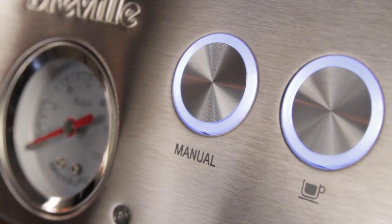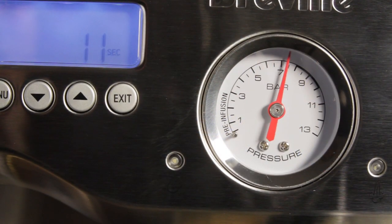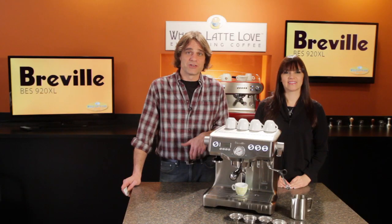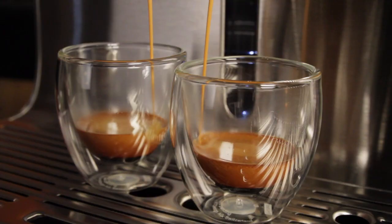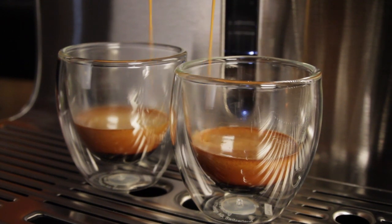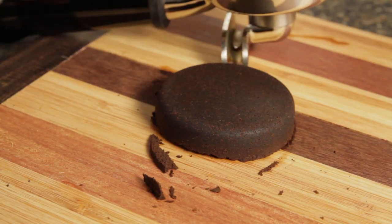Or you can go completely manual with a dedicated button for that. It's got a pressure gauge that will help you dial in the grind, temperature, and pre-infusion settings by letting you know when you've got the right pressure at the brew head. The machine has an OPV valve to relieve excess pressure so you can't go too high and end up with bitter shots. Another pro feature is a three-way solenoid valve. At the end of a brew cycle, it relieves pressure and excess water from the system, so you end up with a nice, easy-to-knock coffee puck.